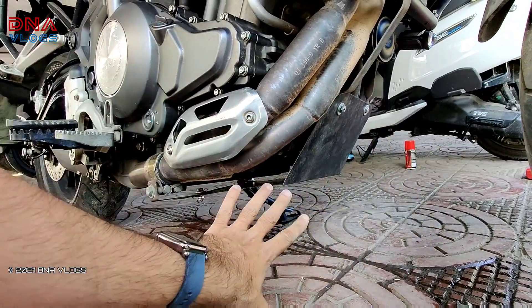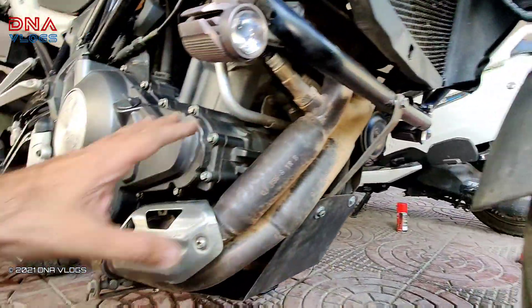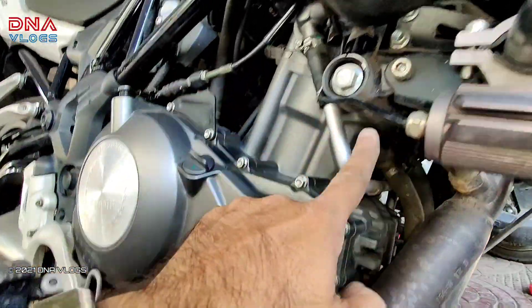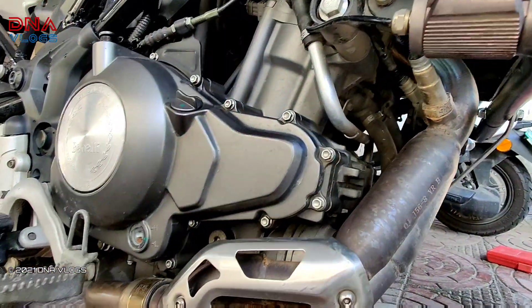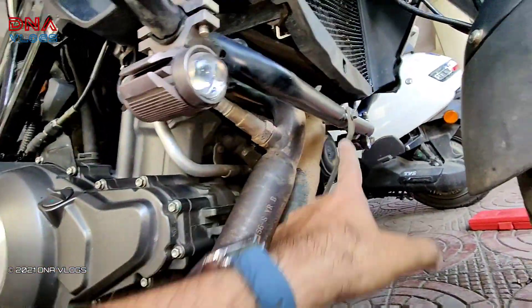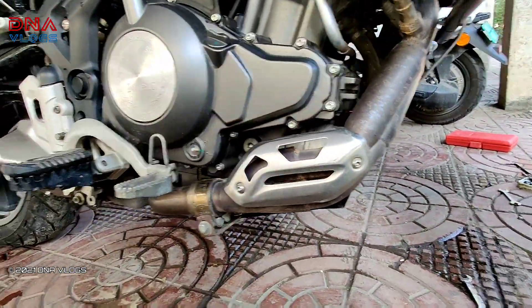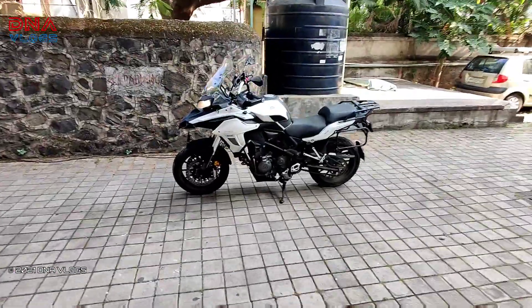For such instances you should always have a chassis-mounted bash plate. Of course this looks a bit rough because we don't have proper chassis mounts in this area. We could have taken it from another point but that would have become very long and there isn't easy access to the chassis there. So I took the closest available mount.